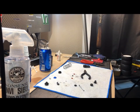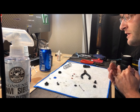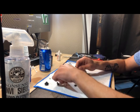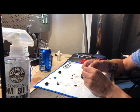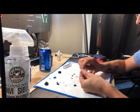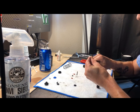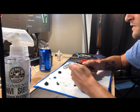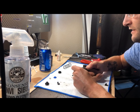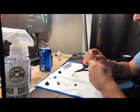Now that we have the shock completely disassembled and cleaned out, everything is ready to be reassembled - or if you are at the stage of a brand new shock and need to learn how to put it together, this is how we do it. Basically what we did to take it apart, we're just doing the exact opposite steps. Take your c-clip and you're going to clip the c-clip in. Proper tools come in very handy here - I loaned my tools out at the track this weekend and never got them back. So take it in your needle nose pliers and clip the bottom ring back into place. It's going to be kind of difficult because we just lubed up the shaft. But there you go - we have the first c-clip on the bottom ring.